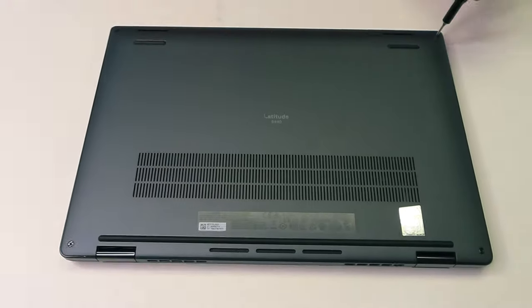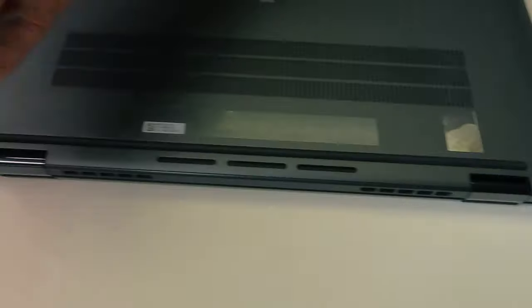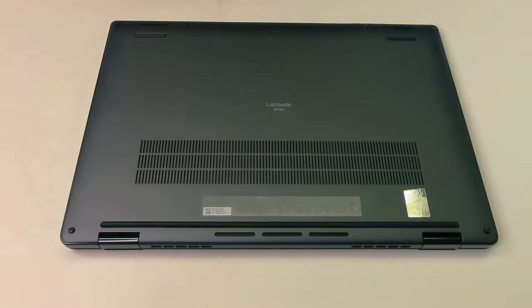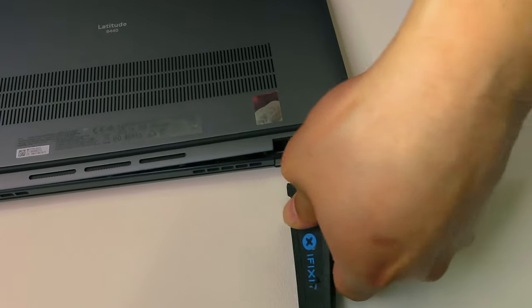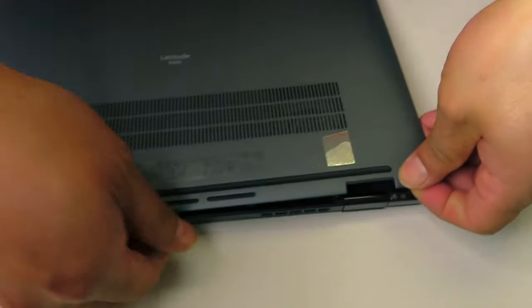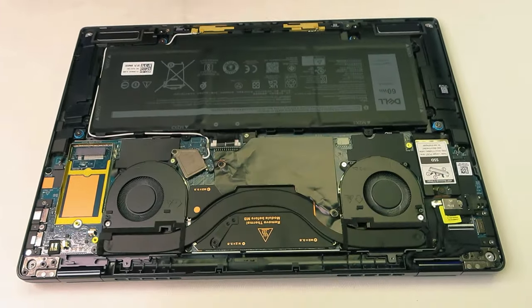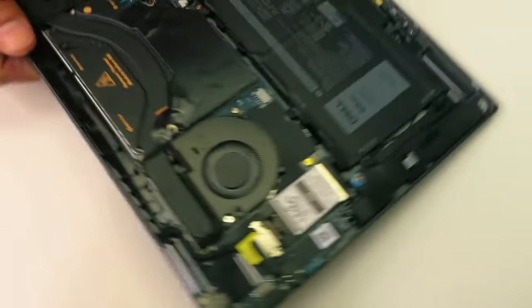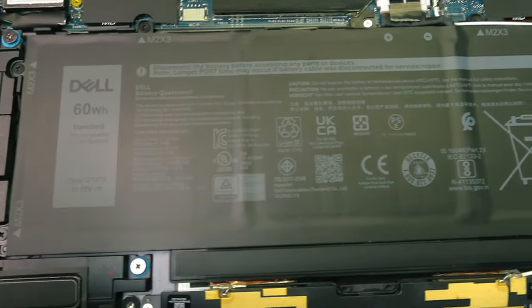As usual, I'm going to start from the bottom case and remove all the screws — there look to be about six of them — and the bottom case will pop out like butter. I'll use my pry tool and simply pop one of the corners. I'd definitely recommend starting from the rear part, because up front there are internal mounts you could potentially break. As you can see, the bottom case was removed super easily.